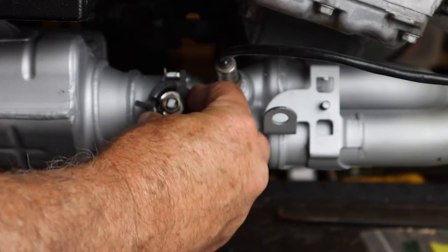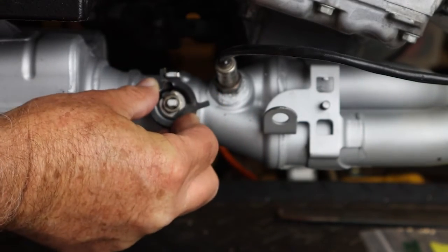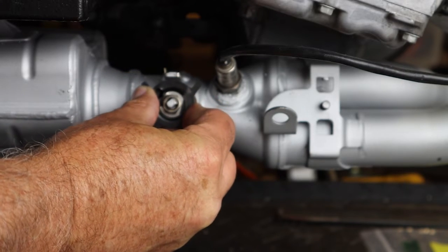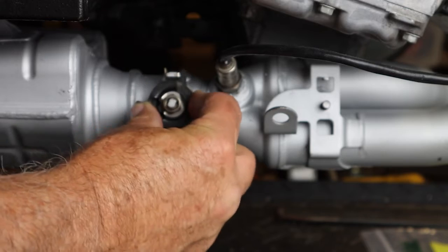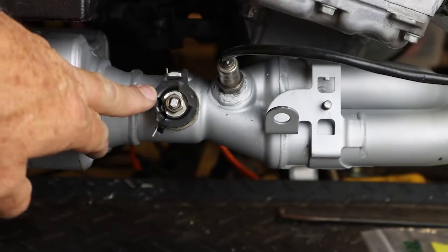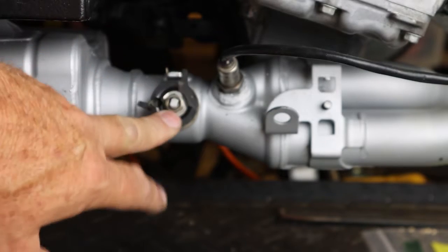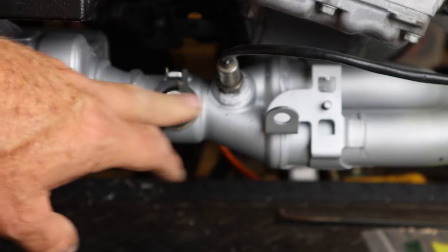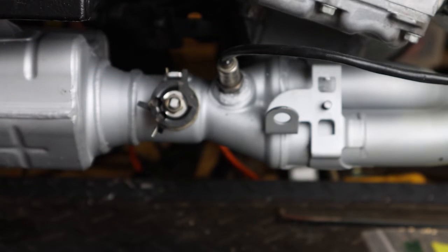When you turn the ignition on, it's going to rotate to the open position and then back however many degrees the specs for your bike shows. Okay, so we have that. That's how you mount the butterfly valve retainer clip and spring, and that's how the butterfly is going to rotate.